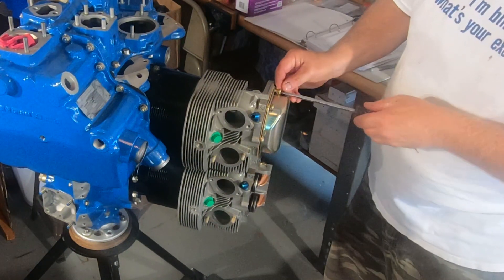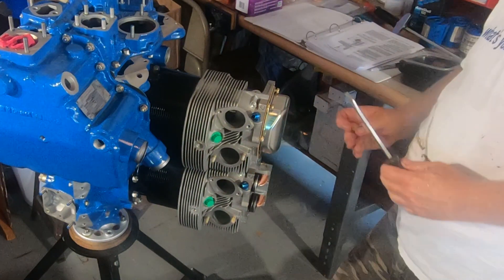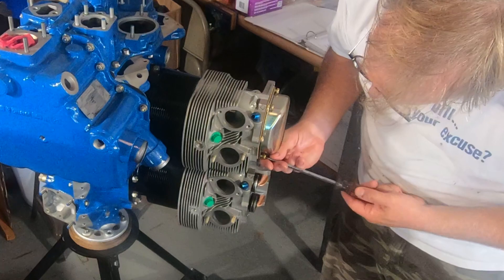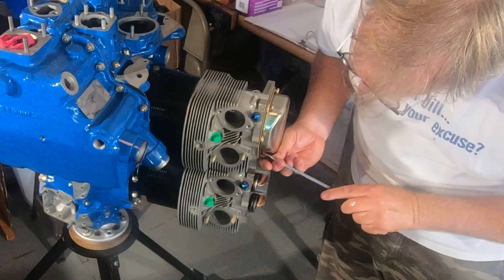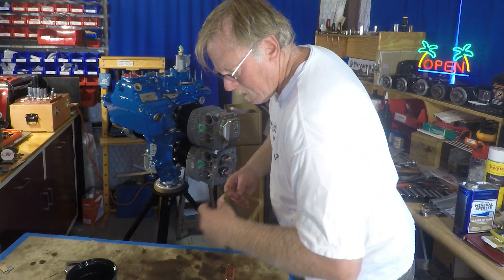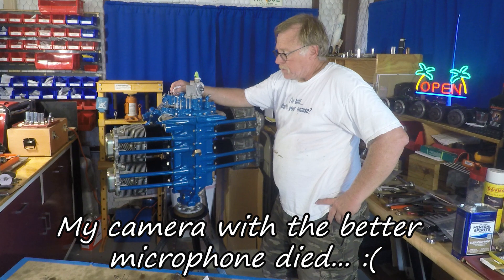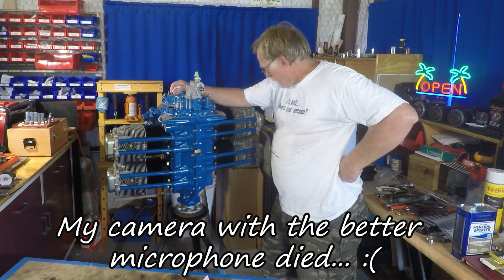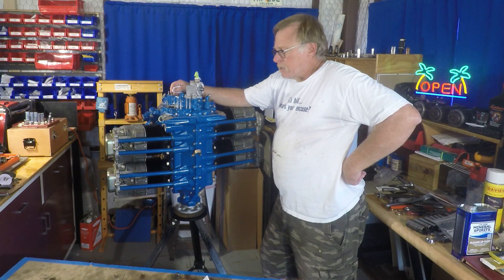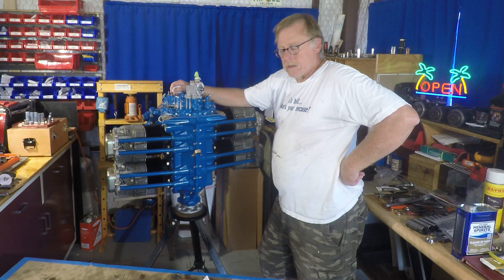These are going on with all new hardware — the cylinders come with all new screws, washers, gaskets, and valve cover. It's a very complete system, so kudos to Superior for doing a good job. That about wraps it up for this episode of putting the valve train in. The valve covers and rocker covers are all done. Next episode we're going to finish up some of the intake tubes and some miscellaneous hardware in the back of the engine.